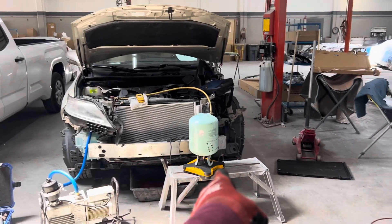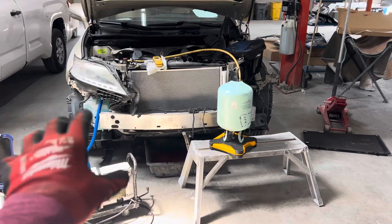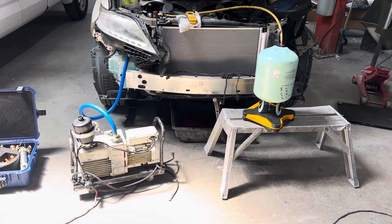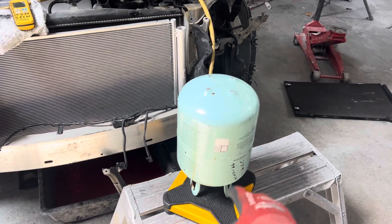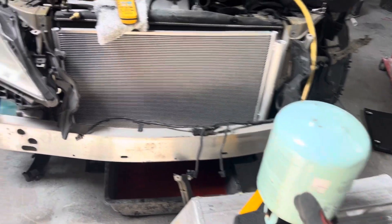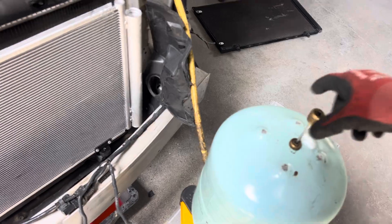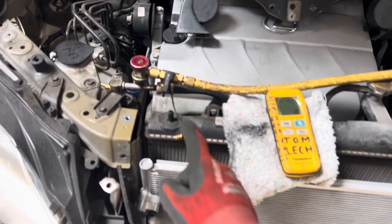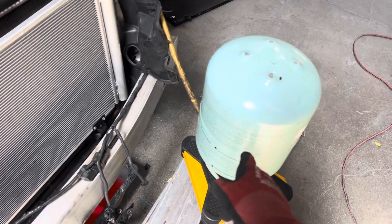2013 RX 350 — going to charge it with a single refrigerant hose, no gauge, no measurement devices. We're going back to the old way, no fancy equipment. They actually had something better back then: soft copper to your vacuum pump. We've got a can, we've got a scale. It doesn't matter if it's a one-ounce can, several in a row, a can of AC Pro — big cans, little cans, it makes absolutely no difference. Let's zero this out. Here's a core removal tool — quarter-inch stem — going to our adapter on our tank, in the liquid position.